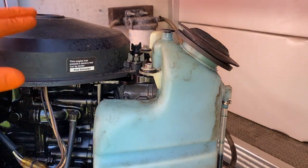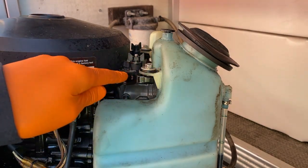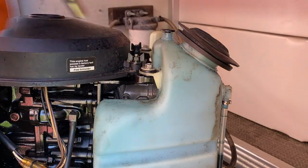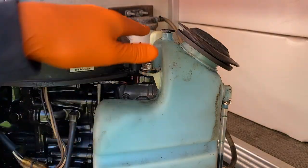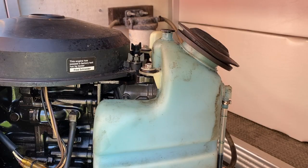Camera down — here's the flywheel, and here's the oil tank. On the very top, where the oil tank secures into the bracket, you've got two 10-millimeter bolts. We are going to carefully remove those. Just be careful as you do this, because once you remove those bolts, the oil tank will basically fall back. Because of that, I've got some bungee cords I will use to properly support it.